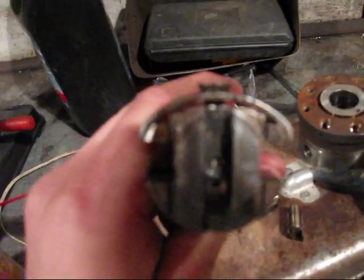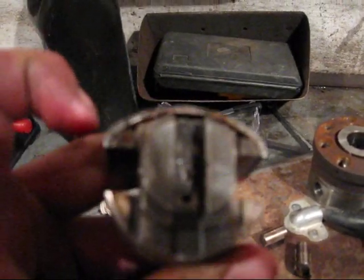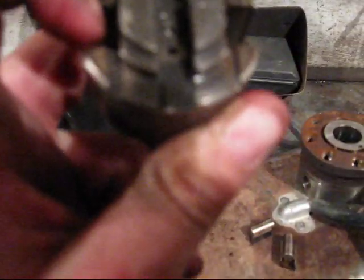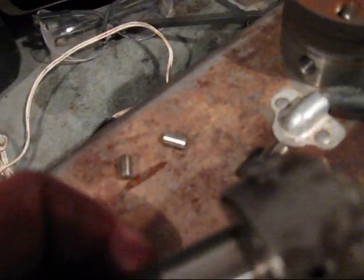This is the fuel adjustment leaf and screw. Basically, from what I've seen, the tighter you screw it in, the leaf squishes downward which raises the edges outward, which lets the rollers slide out more — which means the plungers can slide out more — which all adds up to more fuel. Not a lot more, but more fuel. This fuel adjustment leaf and screw is the one and only fuel adjustment on these pumps.